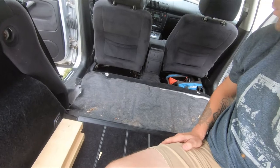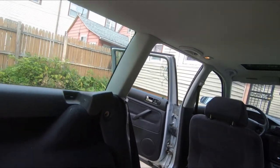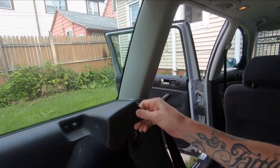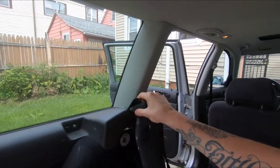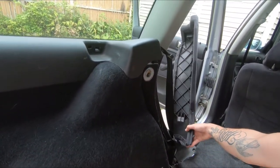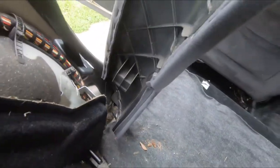As you can see, we got our back seats removed. I believe where we left off last time I was getting a couple of bits and bobs removed. The next step I wanted to do was get these seat belts removed — but come to find out, you actually don't have to remove them at all. You can just tuck them right behind this piece of paneling. You just pop this thing up and over, then slide your seat belt right back behind there.